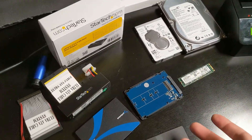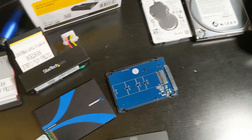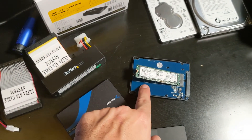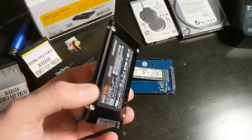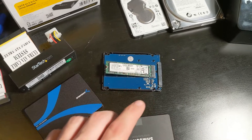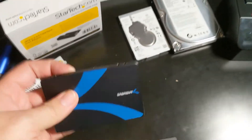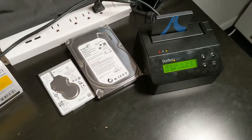Now let's take this M.2 SATA drive and put it in our conversion kit. You can pick this up for around $9.99 on Amazon — stupid cheap. You can basically take an M.2 drive, but this is only for SATA. The SATA M.2 is basically like a regular SSD performance-wise, just in a much smaller package — it's a little bit faster. The NVMe is about four times the speed of this, so if you want really good performance you definitely want an NVMe drive. Unfortunately this converter can only do M.2 SATA drives — it cannot do NVMe. Make sure you know whether you're converting a SATA or an NVMe before you buy.